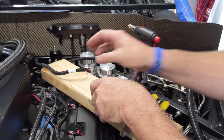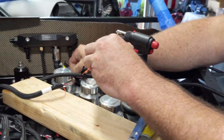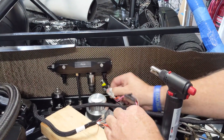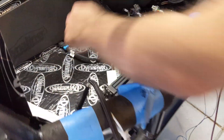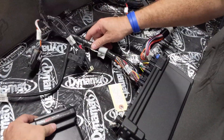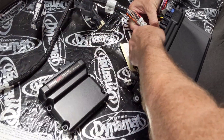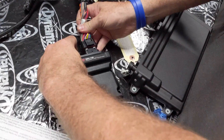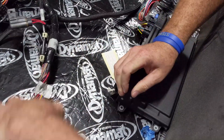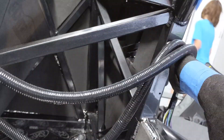We're going to do a little soldering here to make the map wiring go into our connector and into our map sensor, just like so. So you've got the Dominator all plugged in, starting to — just making sure we have everything we need. We need an extra power cable. We've got our VVT hooked up. VVT goes here. These are going to mount right there — we'll make a plate, just mount them right inside the footwell.